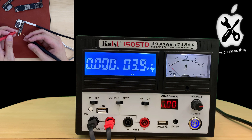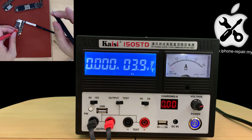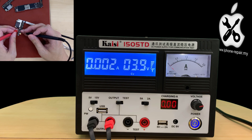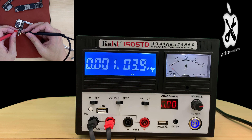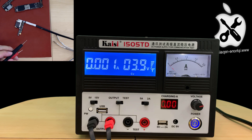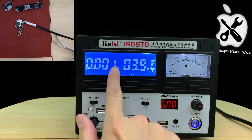In order to test whether the power IC is still functioning, we can press the power button without the CPU. You will see there's a small current — it will stay at a small current. If I press it, you see there's a small response. Every time I press it, it will flow. Now I don't touch it — now I touch it.